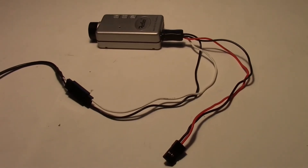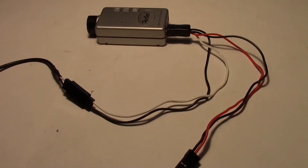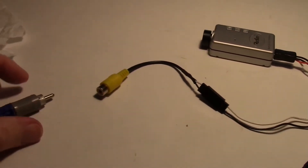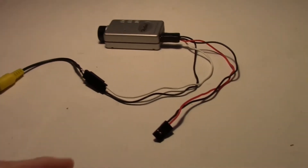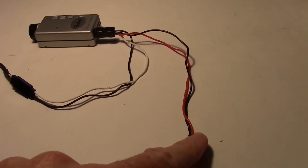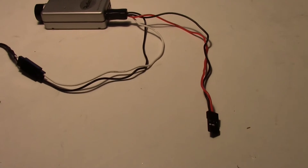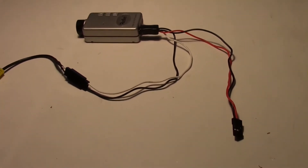Here is the provided cable that you can use for putting movies onto your TV screen. This cable has the video and ground, which will go to the RCA jack on your TV as composite video. The other jack can provide 5 volts to the camera to keep it charged while it's running. Now if you want to charge it while you're recording, it requires about 1 amp of current minimum — so you will have to provide that 1 amp.